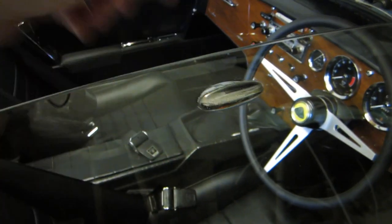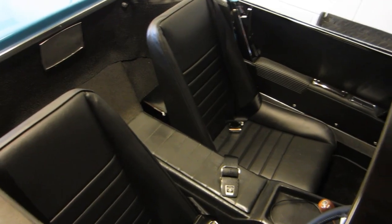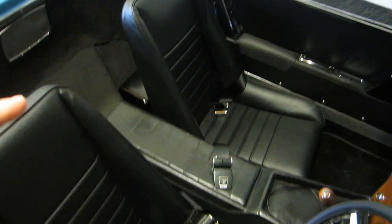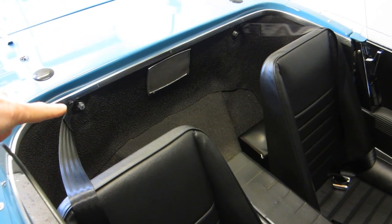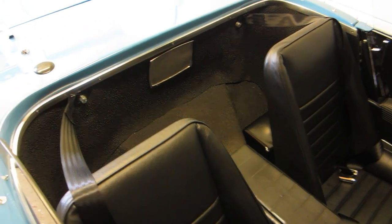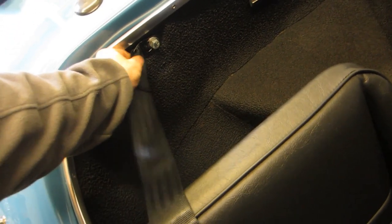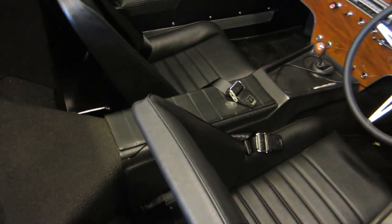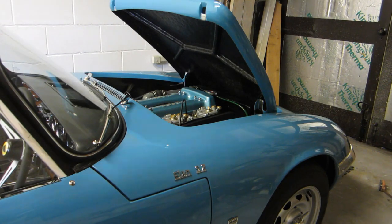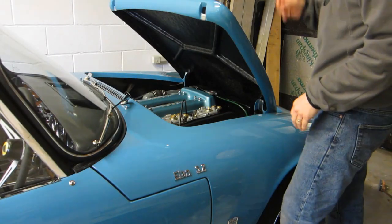I've put some clear silicone sealant on these lifters so that one doesn't rattle anymore, and I've fixed the other one in place on the other window. Seatbelts — these are the type that were fitted to the later cars. They pick up on the bolt that goes through to the chassis at the back, with a nice spacer washer so they can pivot round. Behind the seat there are a couple of rings and I've managed to bolt them onto those rings, so they're nice and secure.